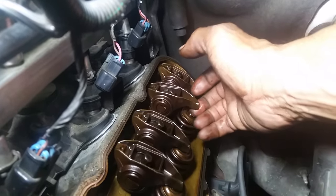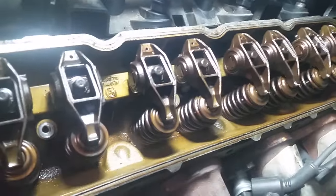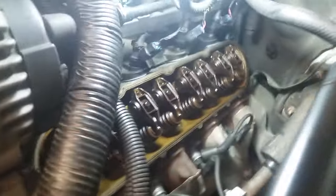That play is totally unacceptable — it's prime indication of a collapsed lifter or bad rocker arm. To replace that on this particular model, you have to pull the rail with your rocker arms on it. Up under the head you have the lifter, so you actually have to pull the head off the car as well, take the intake off and all the other stuff that's in the way. The lifters sit right up under the head and fit down into the block of the motor.